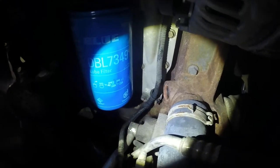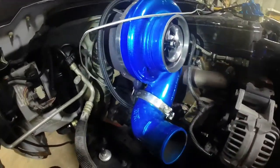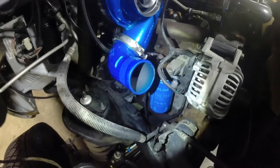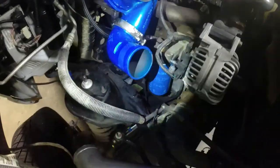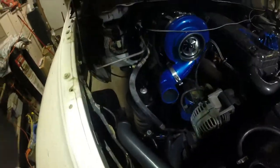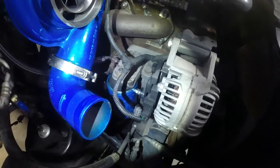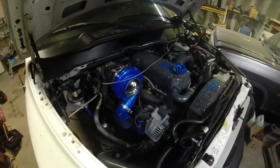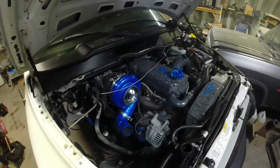We've been working under here too — I had to pull the coolant line right on the back side. It comes out and goes to the heater core; it's the one that runs up underneath the manifold back to the heater core and actually around back to the heat exchanger. I went ahead and pulled that and will make a new line out of braided stainless going from there to the heat exchanger, following close to the same route as the stock line. I am also pulling the second battery — not going to run it anymore, just going down to one battery. I'm going to get a new wire made to go from the alternator to the driver's battery. It's pretty much a wreck under the hood but it will get back together eventually. Got a lot of wiring to do this coming week in the afternoons.